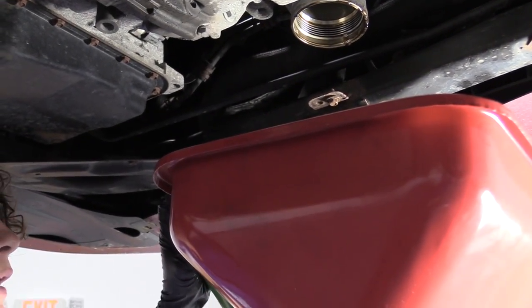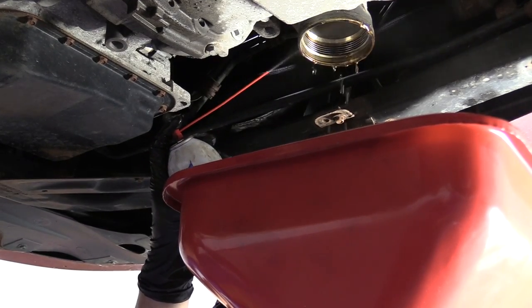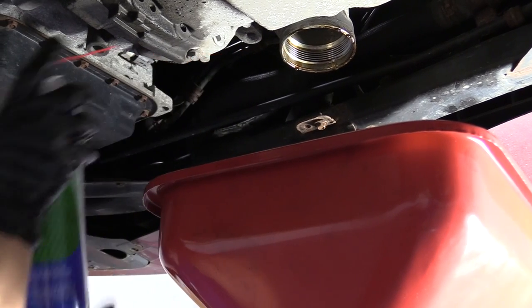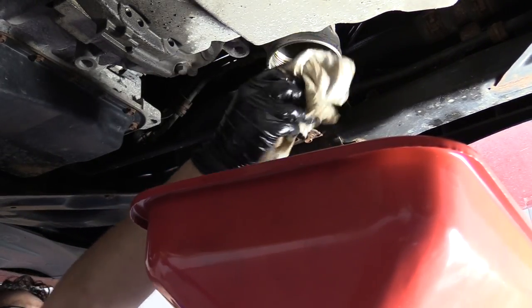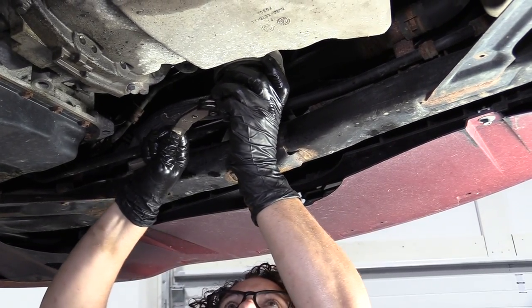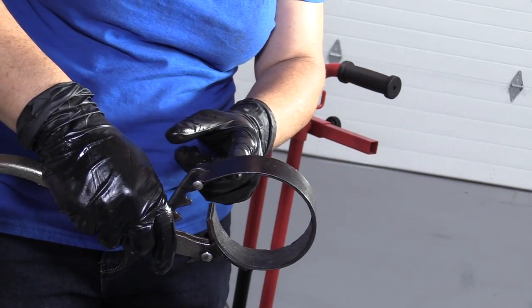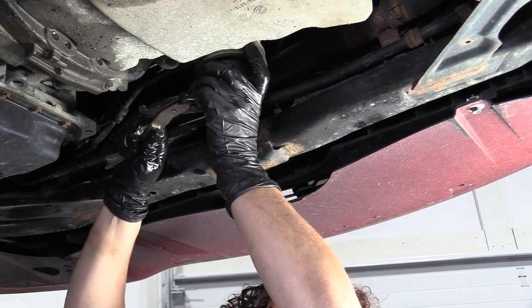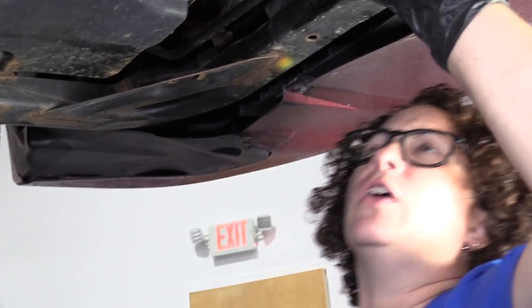Before I install my new cartridge filter in the housing I've just cleaned, I'm going to take some parts cleaner and clean the old oil out of the threads of the housing. I'm not shooting straight up because I don't want it to get into the oil pan — I just want the old oil off the threads. Then you can use a rag to put it up in there and make sure it's clean of any debris. To tighten up this plastic housing, I have an adjustable oil filter wrench with a rubber coating on it. So when it grabs that plastic housing, it won't crack it and I can give it a good tighten. Now you'll notice when it bottoms out, you'll see and feel it, and I just give it a little snug. They want this torqued to 23 Newton meters.